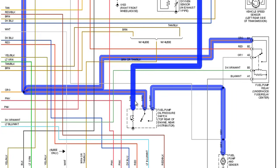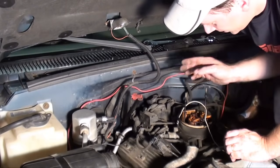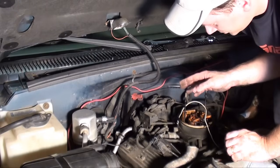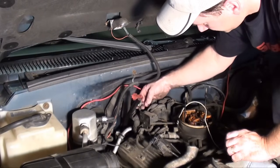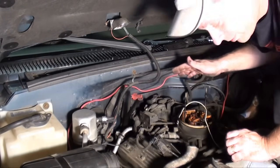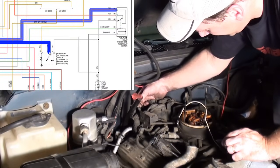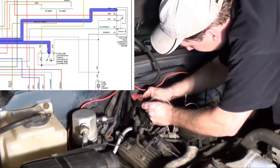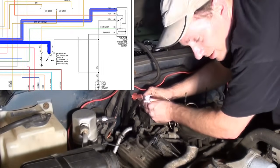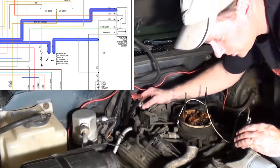So this tan wire goes up to your oil pressure gauge. The next thing I would do is make sure I have the correct control voltage and everything going to the pressure switch. So you want to unplug it. As you see, I have it unplugged — I got the air cleaner removed to get better access. And I got the pressure switch. By looking at the wire schematic, it should be this orange wire. As you can see, we have control voltage. So let me see if the fuel pump kicks on when I install the jumper.